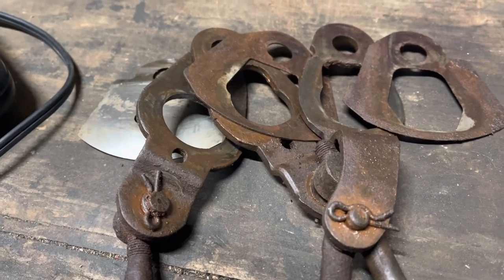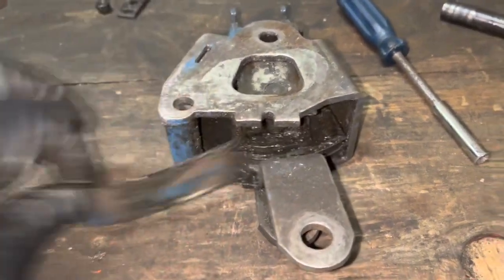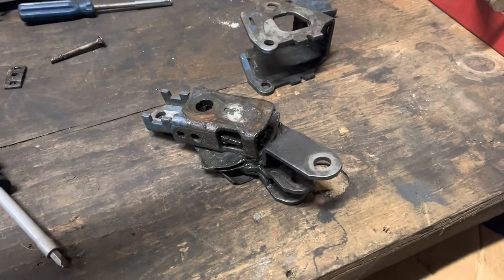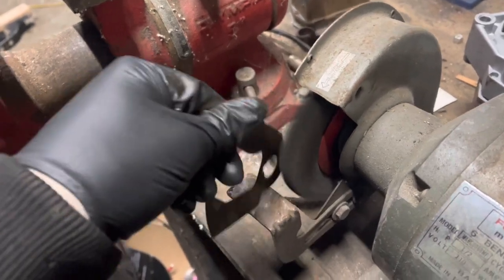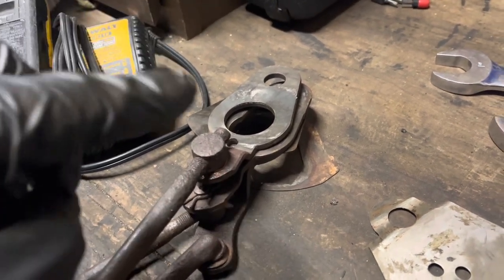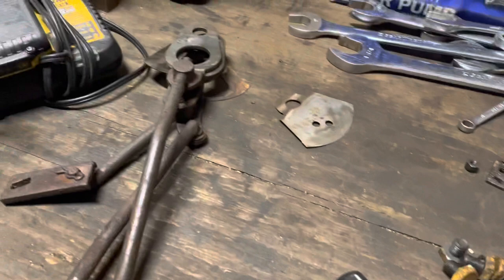The levers are actually shaped slightly differently — mostly reverse. I think it's going to be fine. I don't have the correct reverse rod, so we'll just wing it. This one has this spring dust plate thingy which the other one did not have. Here are the guts out. Here it is assembled as I envisioned — it seems to fit, I think it's going to work. Now I'm just going to clean the crap out of everything; this old bench grinder wire wheel is getting a workout today. I got all the bits clean. Despite trying to keep them all in order, I somehow flipped the 1-2 and 3-4 rods. But that's why you keep an example. Now I'm going to apply a light film of grease to everything in here, pray that this thing is sealed tight enough that road grime doesn't get in there — although I'm sure it will — and assemble it.